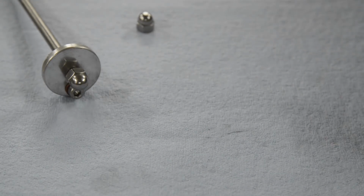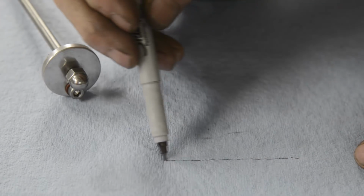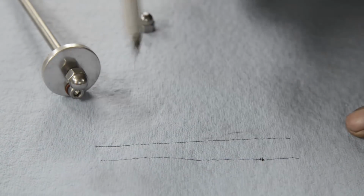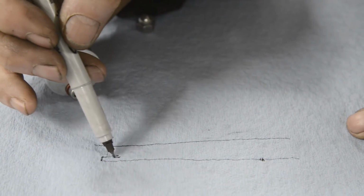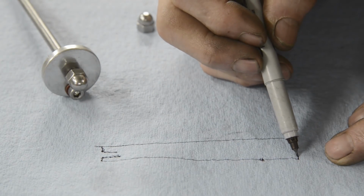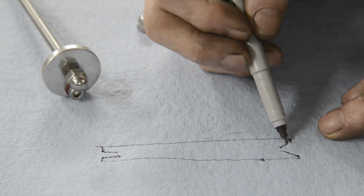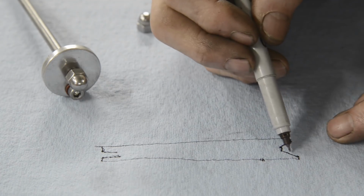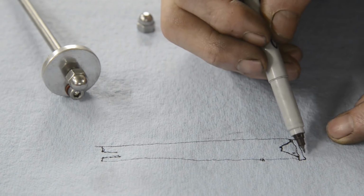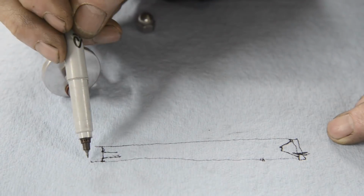The through spindle, actually, the one the bearings are on, which has got holes in it for the oil to go through, at one end it's just flat like that, but at the other end it comes in and then it's cone shaped like that, and that, I presume, is to give you more space here when this piece is on to have your oil going in, because there you wouldn't be able to do it.